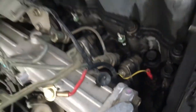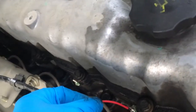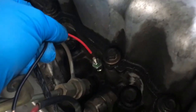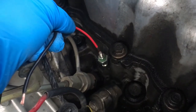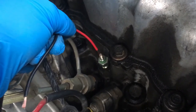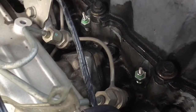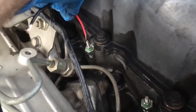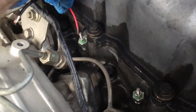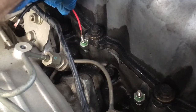Real simple — we don't want to touch this wire on an earth, that's going to give us a big spark. What we want to do is just touch it on the terminal on top of the glow plug and give a little flip. So that first one has got a bit of spark in it — that glow plug is probably all right. This one here: nothing at all. So that is a dead glow plug.